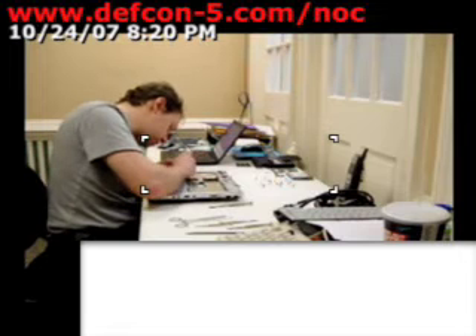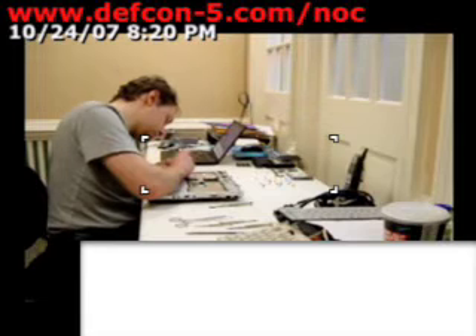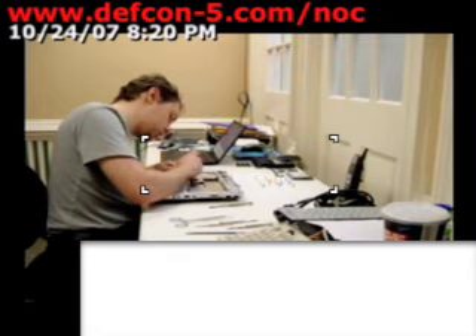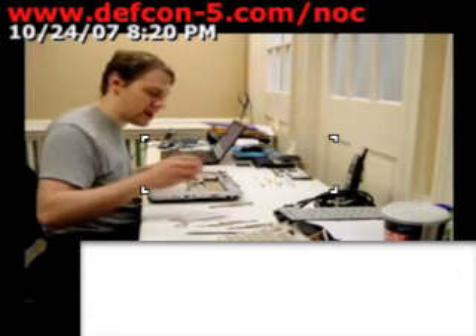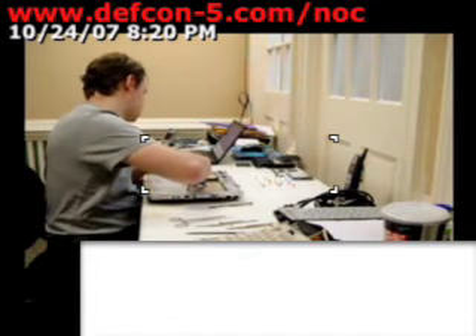So how do I get this guy out? Dental pick. Just go to each corner and pull up on it just a little bit, because the corners are pretty safe. You know they're not going to put a resistor right in the corner, or a diode or anything like that. So you just take the very corner with just a tiny, tiny bit of pressure and it'll wiggle loose.